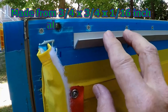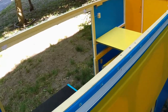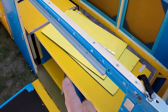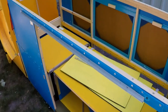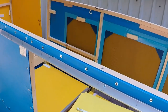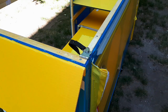The material for the new tracks consists of three-quarter inch by three-quarter inch angle aluminum, bent to 50 degrees. This allows a wider surface for the edge of the hood to rest on, and because of the slope, the edges of the hood slide down against the walls of the camper by gravity. There's one on each side. I also made them 48 inches long instead of 24 inches, which has the advantage of holding the edges of the hood closer to the walls, making a better seal against black flies and mosquitoes. At the end of the video, I'll show you how I bent the angle aluminum from 90 degrees to 50 degrees with a regular vice without causing it to become misshapen.